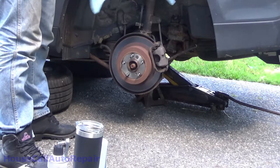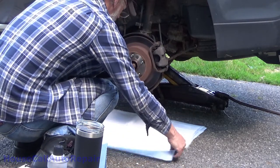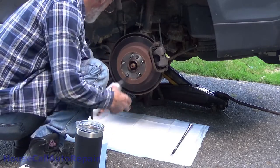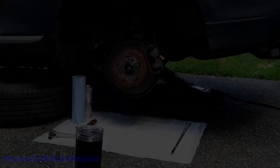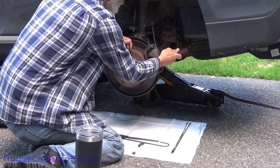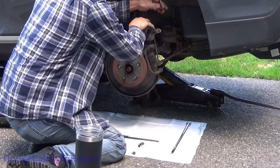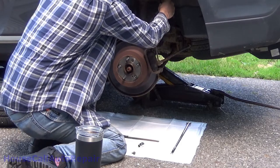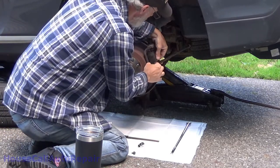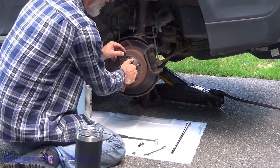Put down our training pad here so we don't trash the driveway. Put some tools down on it to keep it from rolling away. Push the piston a little bit. We'll have our hook right through the ear — find a little place to put it, just shoving it back and out of the way. Those are pretty good. Pop this little rubber piece out — I need to save that for the other rotor.